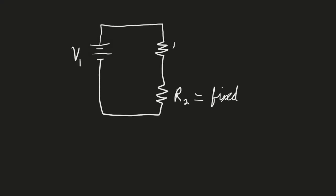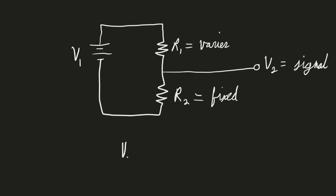In order to actually read it, you need two resistors — one resistor is a known value, and the other is the variable resistor. That way you can see how much voltage is dropped through the variable resistor compared to the known resistor, in order to determine what the resistance of the variable resistor is.